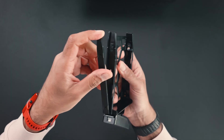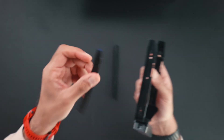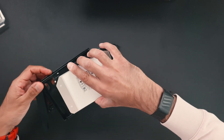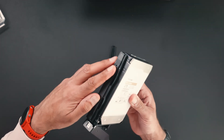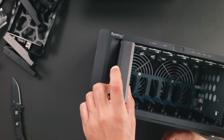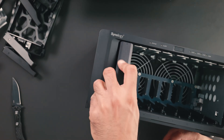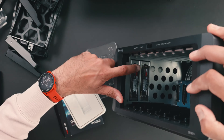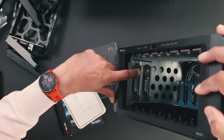Let me walk you through exactly how I set this thing up step by step. First, I installed the four 22TB drives into the NAS. Synology has a tool-less tray system — you just slide off the side rails, insert the drive label-up, click the rails back in, and slide them back into the NAS. Here's my first tip: keep the packaging for your hard disks, because drives are most vulnerable within the first two weeks. Next, I installed the NVMe SSD cache — these install directly inside the NAS in a simple tool-less setup, just insert them at an angle and click into place.